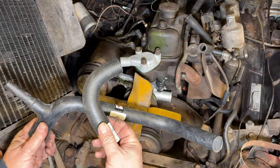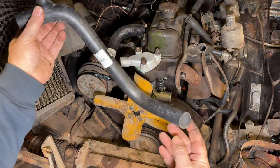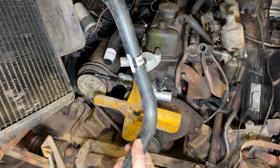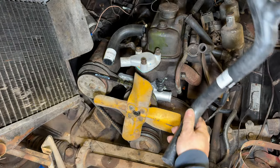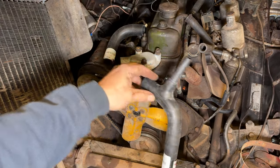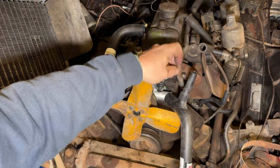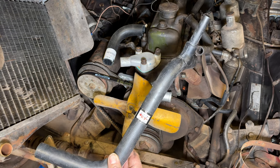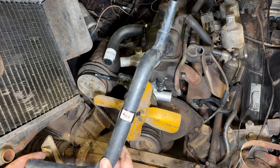Last thing is the two new radiator hoses. This top hose up here is really easy to put on at any point. This bottom one is kind of a trick because it has to go underneath this cross member and then connect up here on the radiator. So I like to stick it underneath the cross member, connect it up to the radiator first, then mount the radiator in — then it's pretty easy to get to this connection and connect it up. It's a real pain to replace this hose if you're not removing the radiator, but if you have the radiator removed, just connect this here before you completely bolt the radiator up and you'll have a much easier time.